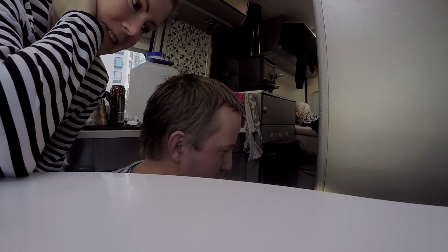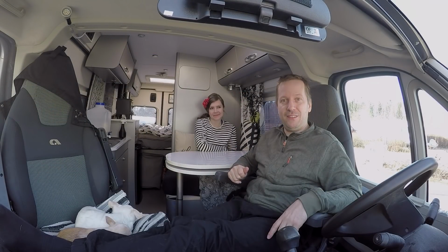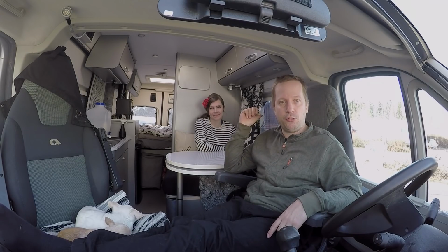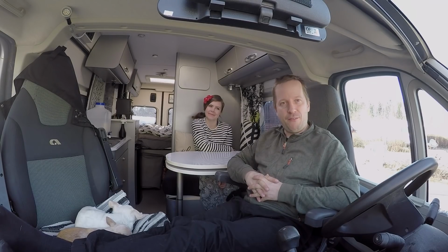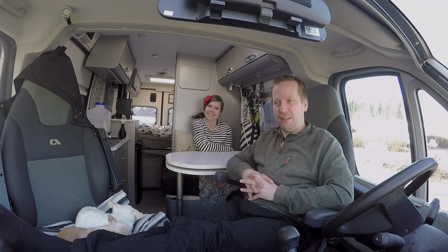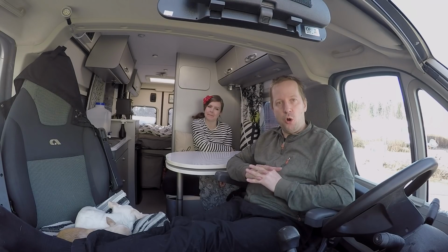Whoa. That's the charger and the blower motor started, because it's giving 45 amps on a small box like this, and it's really dissipating the heat out of itself. And for the plug-in power, when we are plugged into the grid, we used to have 17 amps and now we have a 100 amp charger. Or we don't have that yet because they forgot to put it in the box, so it's still on the way to Finland. But we are going to get it, and then we have 100 amps of shore power that we can charge our batteries with.